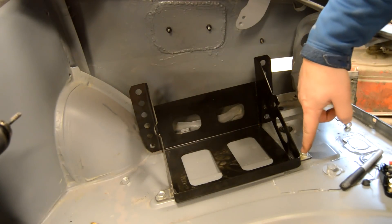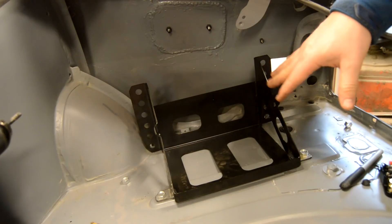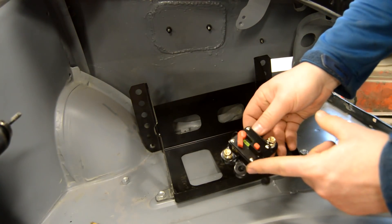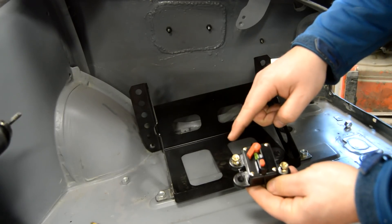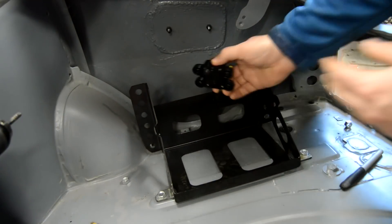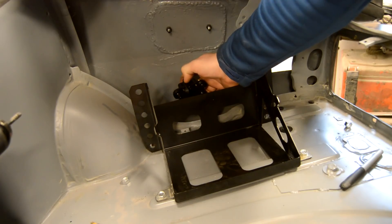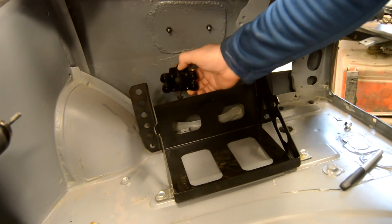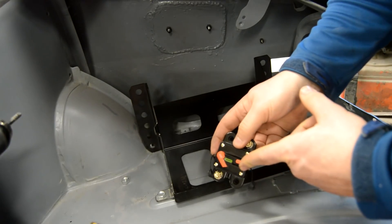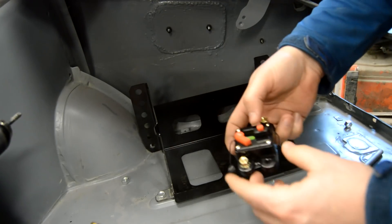I got the holes drilled in the rear floor, so the battery box is basically ready to be bolted in — all the bolts just need to be tightened. But first I'm going to paint it. Next, I've got this breaker switch here that goes in line with the power cord to the front — it'll go right after it connects to the positive terminal. I was debating whether to hide it and mount it to the back, but that makes it pretty much unserviceable because you can't see anything or mess with the breaker. I want to be able to service it and possibly trip it if I go somewhere for a long period of time — it's an extra security feature so nobody will be able to steal the car.